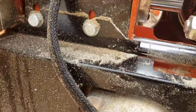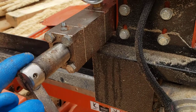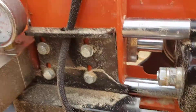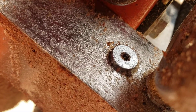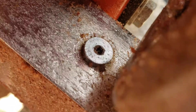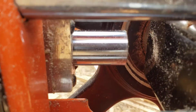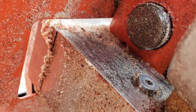The process — if you watch the technician who shows you how to do it — you've got to back this thread off, push that plunger all the way in, and then back the block off. Then there's a little filler cap in there; apparently it used to be a 7/16ths, now it's a hex key. I worry that if that thing strips out, there's no getting it out. But that's not the major issue. The major issue is they tell you to grab onto the end of that shaft and manually pull it out, then add fluid little by little in there.